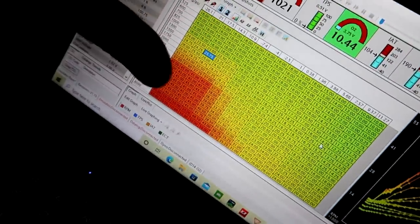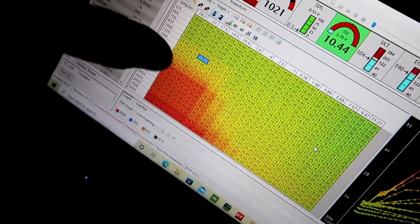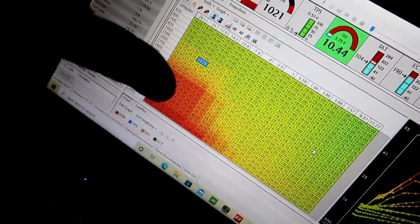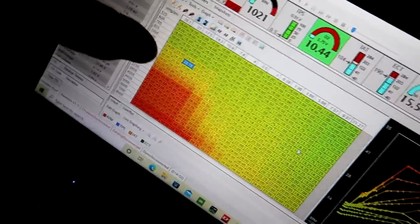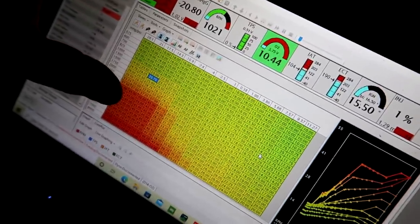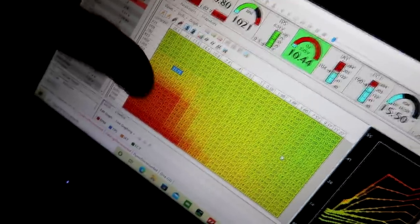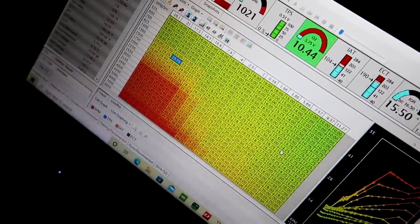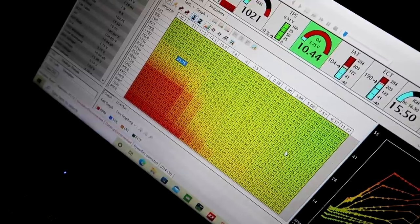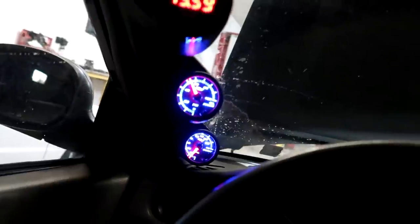All right, guys, I spiced this thing up cruising to try to get some better mileage out of it. I'm gonna run 45 degrees or so cruising on the highway to see if I can get better mileage. I'm gonna let you guys know how that works. Because typically you want to run a lot of ignition timing in cruising and a really lean air fuel to get really good mileage out of these things. The rest of the boost map here looks pretty good, and we're gonna send it with this timing map and see what she does. All right, let's get it.